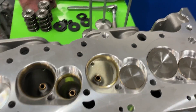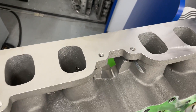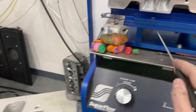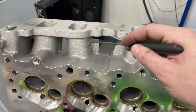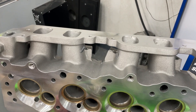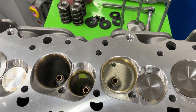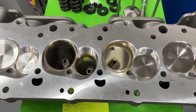What makes it different is this: if you look at the intake ports, they are called a spread port head. Spread port heads move the ports apart. On a conventional big block Chevy, the ports are together like the small block — usually a long runner and a short runner. The spread port design spreads them apart. Warren Johnson might have been one of the earlier ones to do this. Things have evolved and this is the spread port head, and this is one of the more economical — although still very expensive — spread port heads you can get.